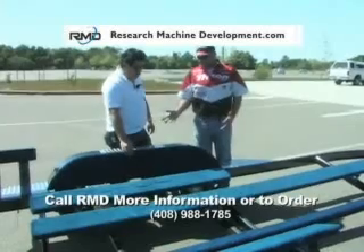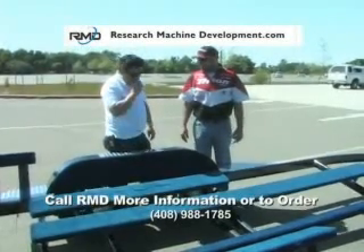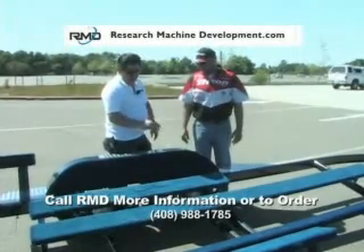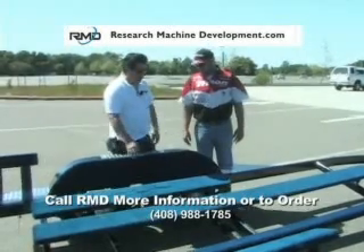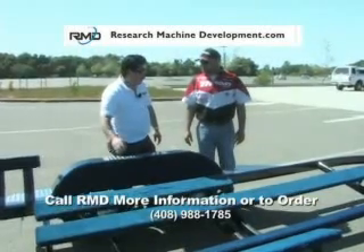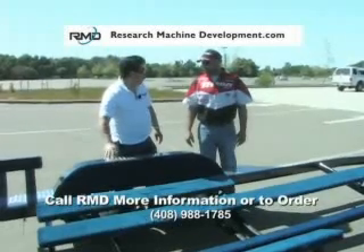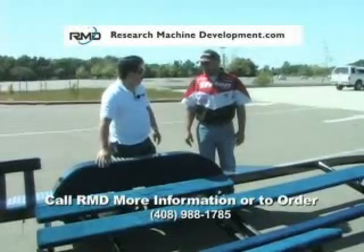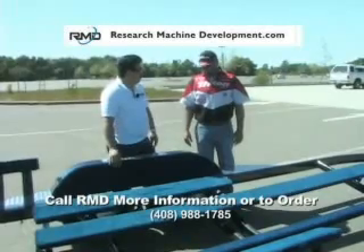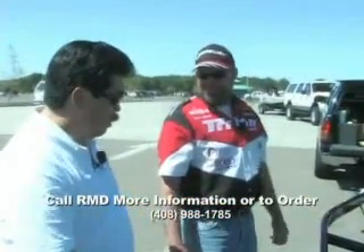Is there any modifications between different trailer manufacturers that you might have to deal with? The only difference, Dave, is every trailer manufacturer has their own way of making trailers. The only problem I come across is the brake line coming right where the unit needs to be mounted. So what you may have to do is move that line out of the way so you can mount this up to that area. Other than that, there shouldn't be anything at all. Well, let's go throw a set on my trailer and see how easy it is.